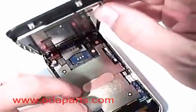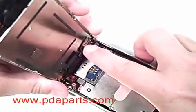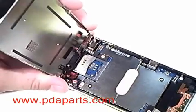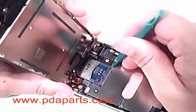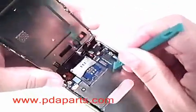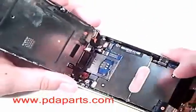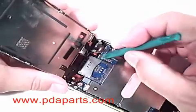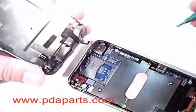There are still 3 cables holding the display to the motherboard. They are numbered 1, 2, and 3. Make sure you remove them in that order. The third one is a little tricky as it is pushed in and not just pushed down on the connector. You'll lift a small white tab at the back of the connector up to about a 45-degree angle, and the ribbon will slide out.